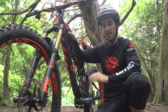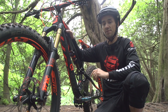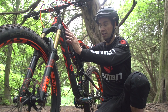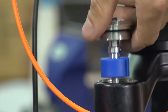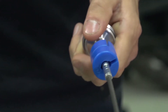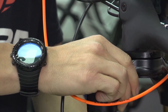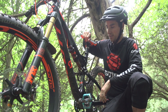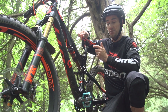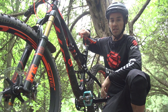Going back to actually talking about adjusting the air in the suspension, there's a more advanced adjustment, and that is changing the volume spacers. They're basically small plastic washers that go in the fork and shock. If you put bigger ones in, that makes the suspension more progressive — meaning the further you go into the travel, the harder it gets to compress that suspension. That's really going to help more advanced riders, because otherwise they'd just have to pump more air into that shock so they didn't bottom out on the big landings, and that takes away from that small bump sensitivity.